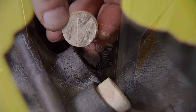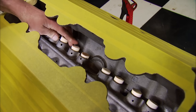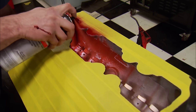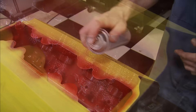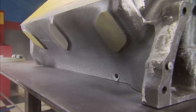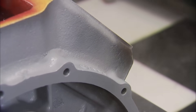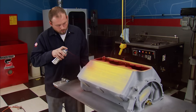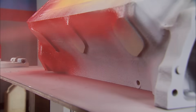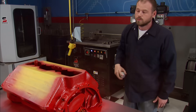After the final wash, we'll be ready to add some color on the inside. We made some wood plugs out of a dowel to protect the lifter bores. We're using a red insulating varnish — it sheds oil, which promotes faster oil drain back to the pan, it won't chip, and it's chemical resistant. On the outside, a smooth coat of Dupli-Color gray engine primer will give us a good base for the final coat. For that, their high-temp red engine enamel with ceramic. The block will get several coats to give it a look that any old timer would approve of.